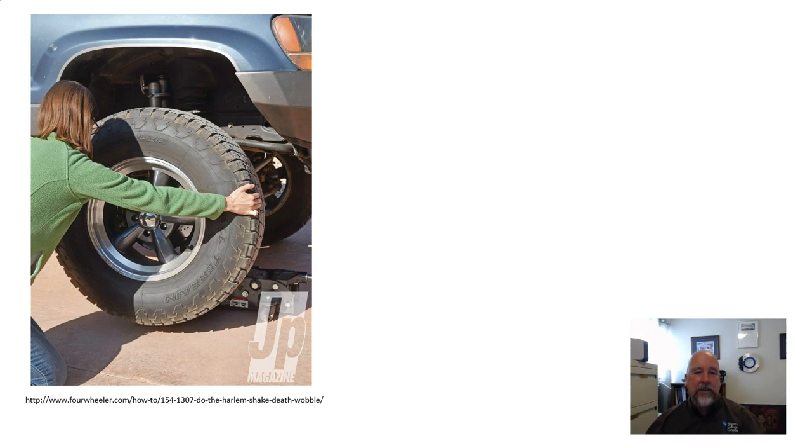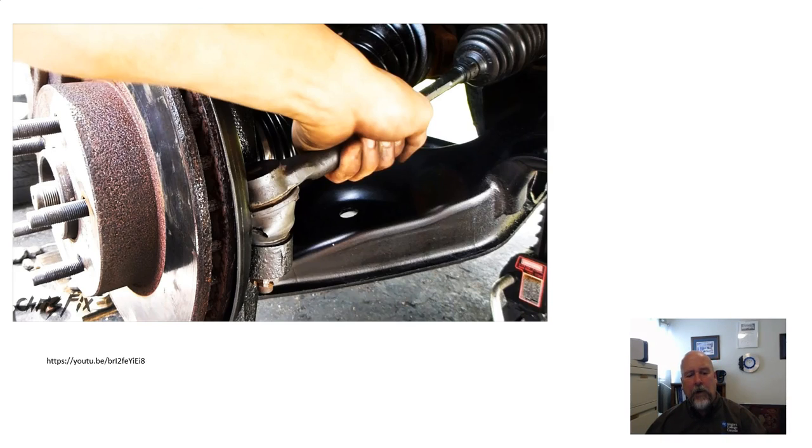Okay. If you have a vehicle with a steering rack, the dry park check is frequently hard to do. There's not a lot to see anyways. So we grab a hold of the road wheel, and we turn it left and right, and we see if we can feel any play in there. And you want to grab a hold of the tie rod end, and you want to try and rotate it. It should rotate smoothly. It might be a little bit stiff, but you should be able to rotate it.